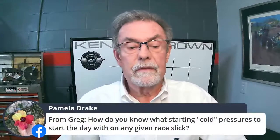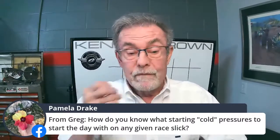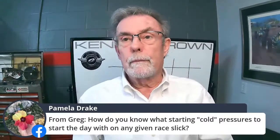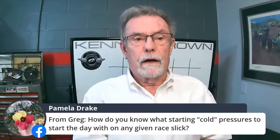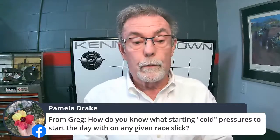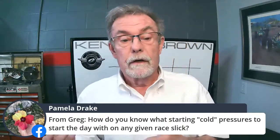Okay, here's one from Greg. How do you know what starting cold pressures to start the day with any given race slick? Okay, race slicks are different than track tires or street tires. A true race slick like a Pirelli works to an absolute pressure. And it's kind of like the only way to know where cold starting pressures are is to start where you left off.